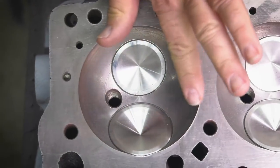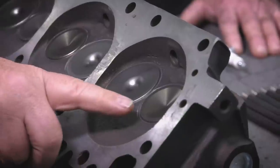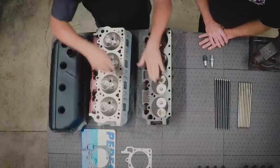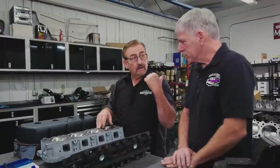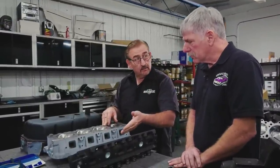Because of the hemispherical design, these opposing valves and this high dome in here, you can get a lot more fuel through this combustion chamber faster than you can inside the wedge. So when we bolt this on the car, that piston is going to come up into this area. On the flat piston of the 440, when those valves open up they're going to want to hit the piston. So on the 440 six-pack, because of the 10.5 to 1 compression, they put fly cuts in those pistons.